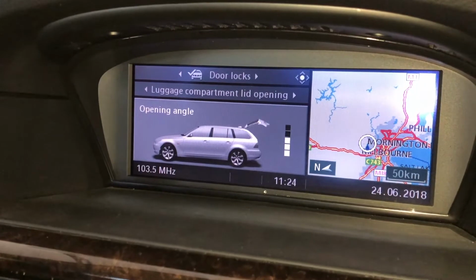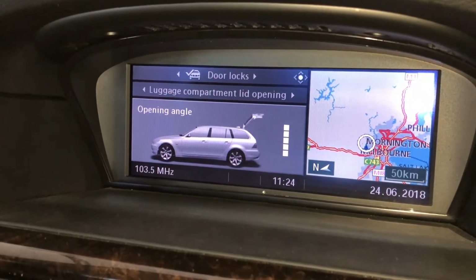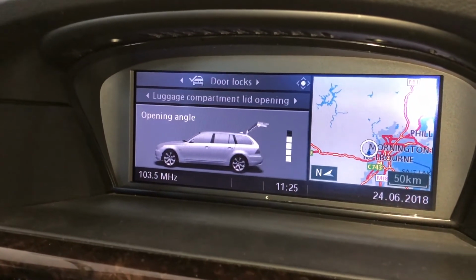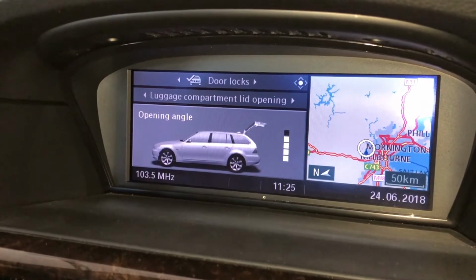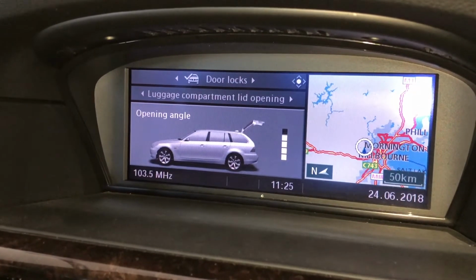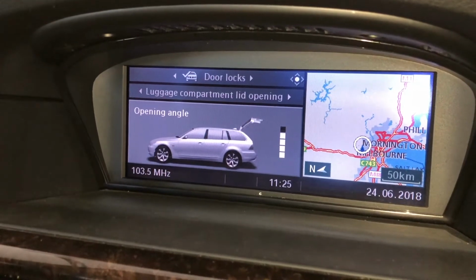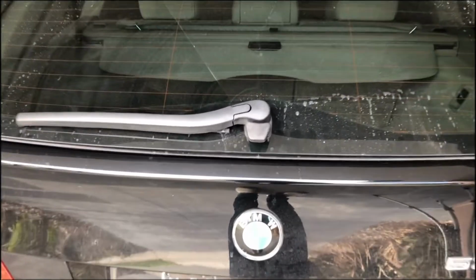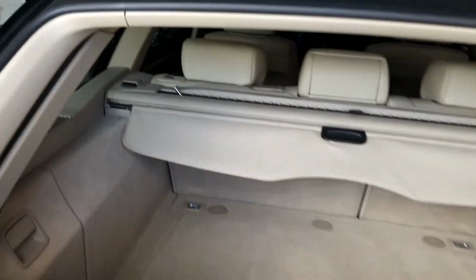But also, you get to determine whether those wires go full stretch every time the tailgate opens, goes up and down. So you knock that back a little bit and all of a sudden those wires aren't under the same tension and going full stress. So there's the preventative maintenance thing. If you've got an electric tailgate, I would definitely come in and knock that down one notch so that the wires are not being fully extended every time the tailgate goes up and down. The complexity of this tailgate is quite amazing when you have a close look and work out what they've had to do in development.